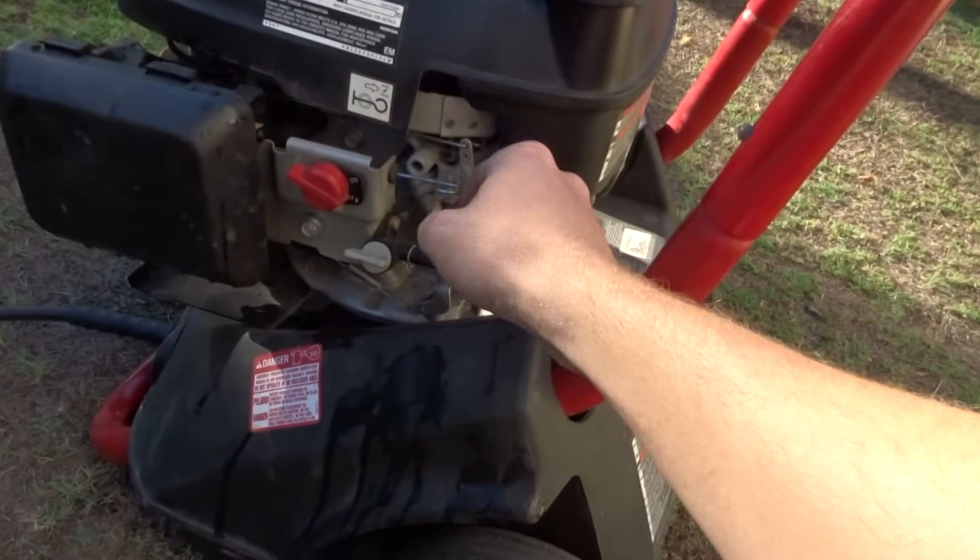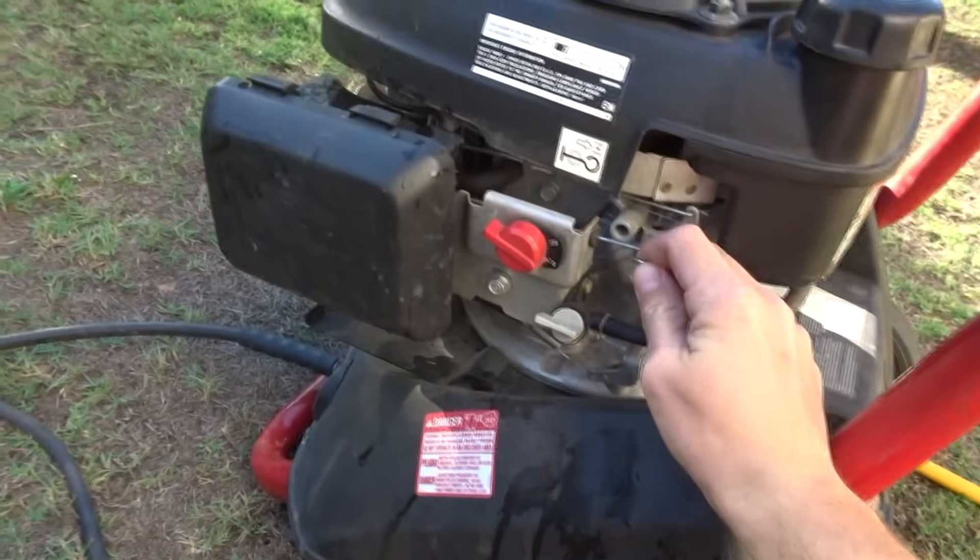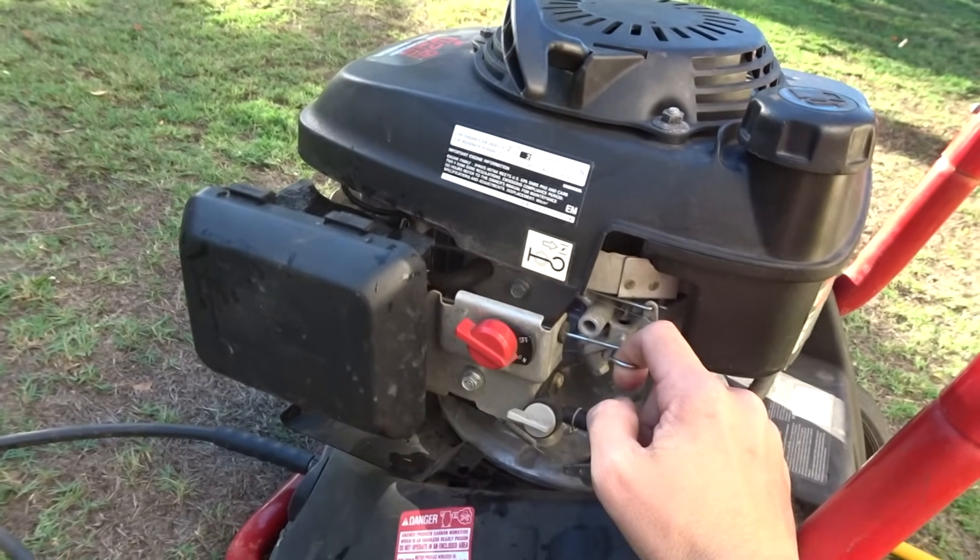The choke is on right now. As you can see when we pulled the choke off it struggled for fuel - that's the problem. It's a blocked jet. It had a hunting idle, where the idle fluctuates and if it's bad enough it stalls, it backfires, and it doesn't run right.